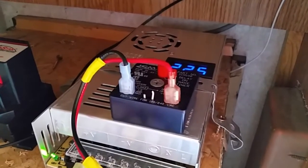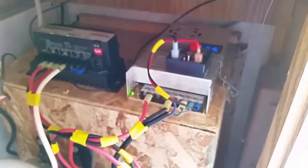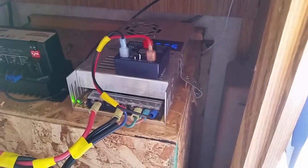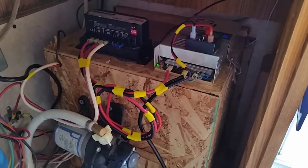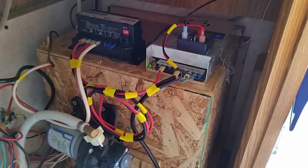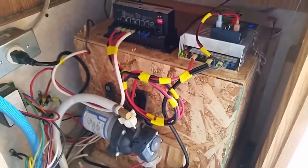This little box you see right here is actually a delay-on timer. I found out that if you let everything sit in the off condition for about five minutes it would power up just fine, so I wired that into the power supply. I also wired in a thermal switch that controls the fan, because the fan came on no matter what anyway. Now the fan will only come on if the power supply is heating up — which would be if you're using lights or a load in the RV, or if it's under a charge condition.